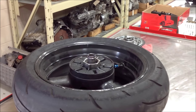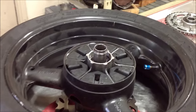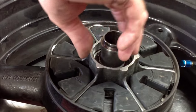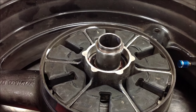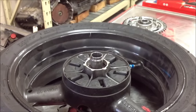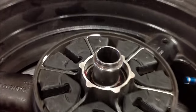We're at Western Iowa Tech getting ready to change some wheel bearings on a Hayabusa — common to all GSXRs and about any other wheel that uses a sealed roller bearing. Listen to this — sounds like a cheap skateboard wheel. The other wheel bearing is just as bad. This wheel bearing set was actually just replaced and we found it to be grossly over-torqued, which can cause those bearings to fail prematurely.